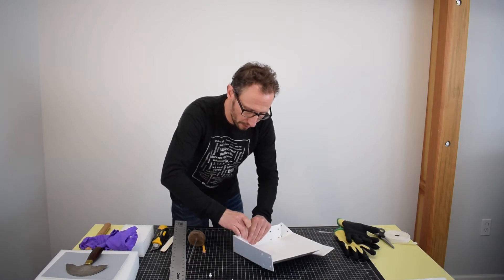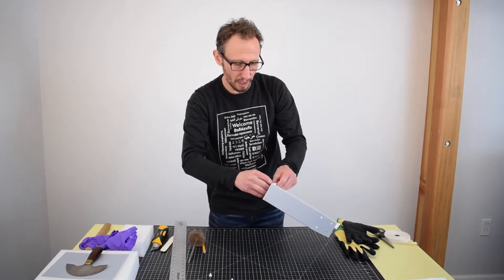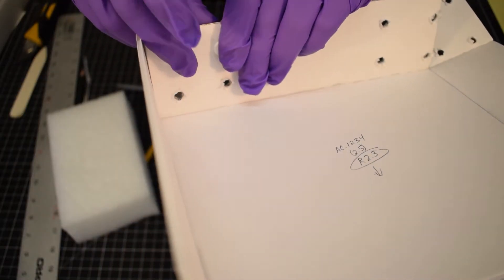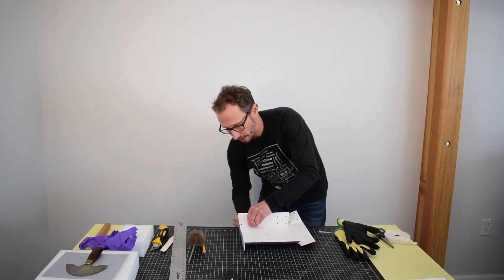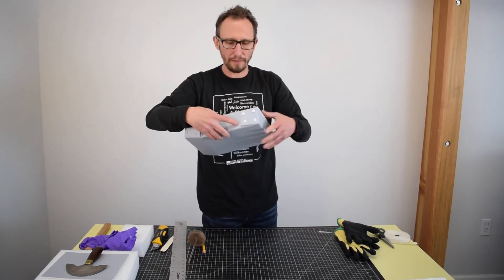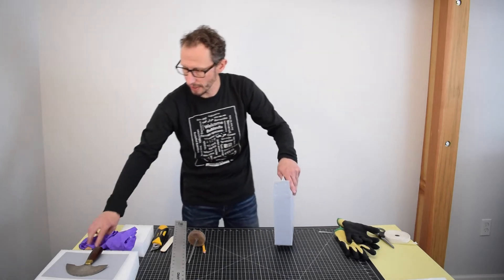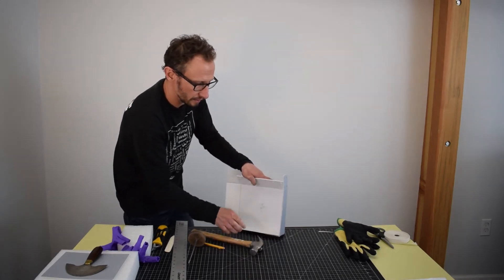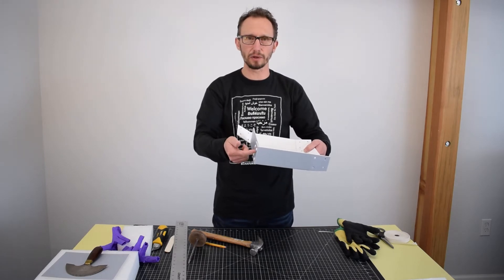So I'm going to fold over the flap and we put the threaded plastic rivet through the inside because it's kind of a yellow tint that the manufacturer colors it. And then we put the white hollow posts on the outside. What we do is we just barely pinch those together. We are actually going to nail these rivets together once they're all in place. So I've got all four rivets in on this particular flap. You just take the hammer and from the inside, make sure your corner's tight there, and you just give it a little tap and that marries those two rivets together. And it is extremely tight — the only way you can get those rivets out is to take a drill and to back them out.